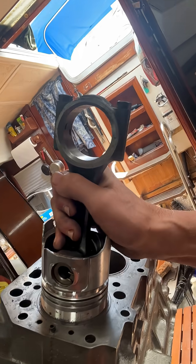You can take these three-stone hones, and over a long, long period of time you can cut them out. This one is starting to accept the piston — I've got it real close, I've spent a lot of time, three sets of stones with this. But this is not the proper tool for cutting the liners out.